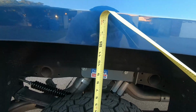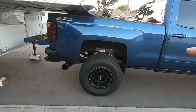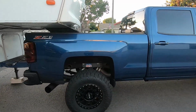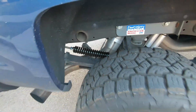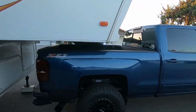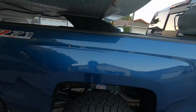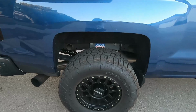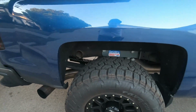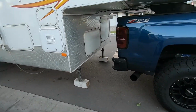Okay. I did this earlier, we're about 11 3/4. And I did another measurement when it was empty and we were at 10 1/4. So at the 40% setting, we gained 1.5 inches. We were at 60 1/4 inch to this puppy right here, right where my fingertips at, to the ground. And then here, the gap we had was 6 5/8. I just measured it, we gained 2 inches, which is pretty cool because, well, these are off the ground.